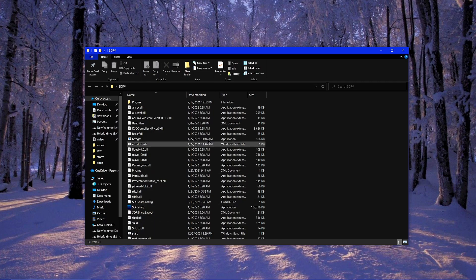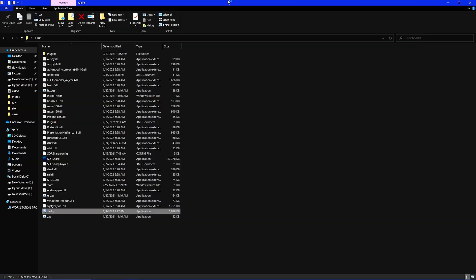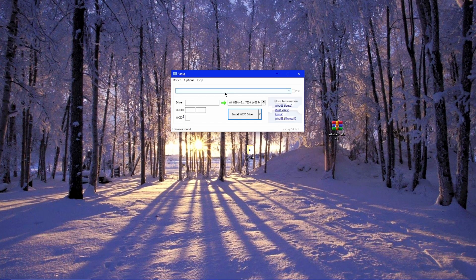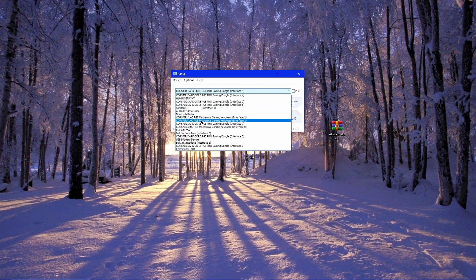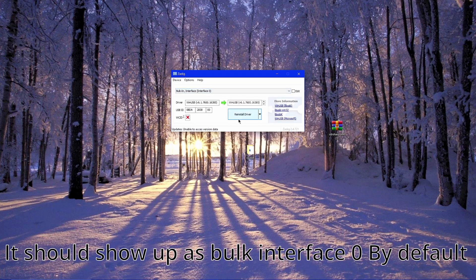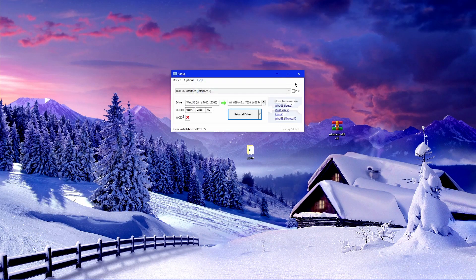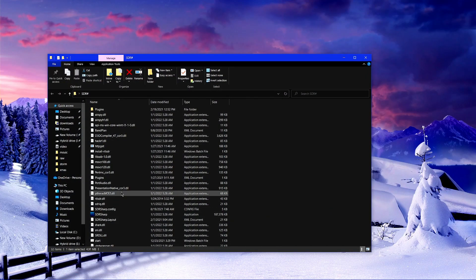Before you can do anything, here comes the hard part. You're going to want to open up Zadig, which creates itself when you run that file we just ran. If nothing's showing up, this can happen if you're on USB 3.0 — I'm on 2.0 and it's still showing up. You can try to list all devices, and look for Bulk-In Interface 0. There should be a green arrow there — click Reinstall Driver. Make sure you're looking for Bulk-In Interface 0 with a green arrow. You can try Interface 1 if 0 is not there, but it's most likely 0. Once it's finished, you're ready.